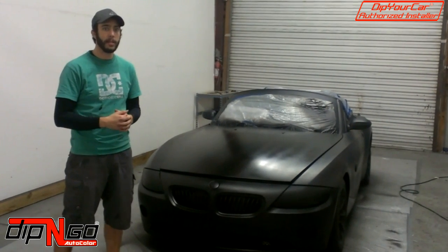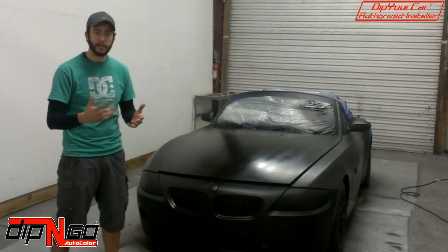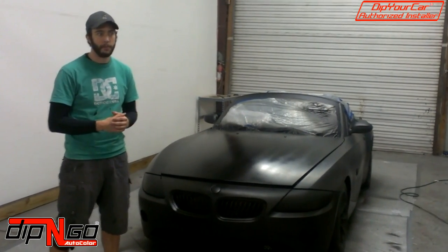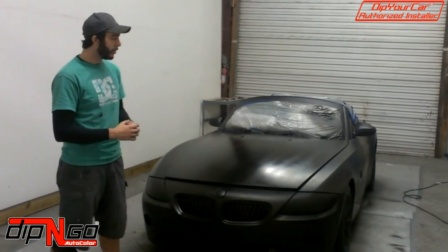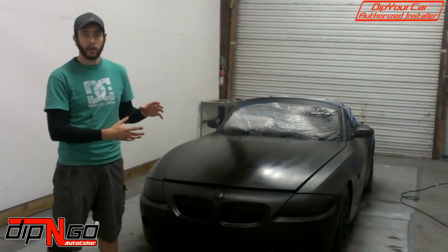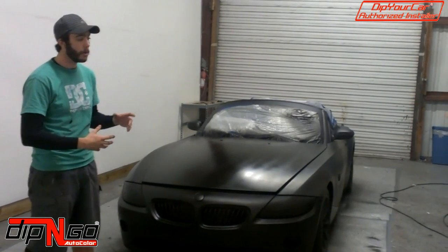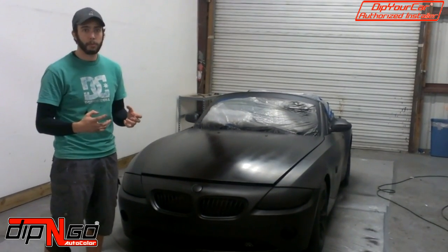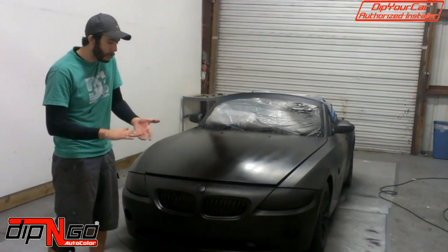But what I really wanted to take the time, while this car was drying, to explain to you guys was my technique. This is how I get that glass smooth finish that I've been showing in my other videos and you guys have asked for. How do you do it? Well, you need to make sure that your first 3 coats are setting the stage for the rest of the entire job. You also want to make sure that when you're applying those final 2 coats, you're getting that nice consistent flow of Plasti Dip out, and you're just increasing it to where when you're spraying, it's almost pooling.